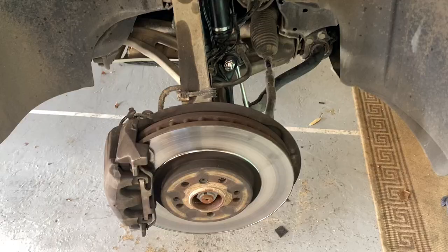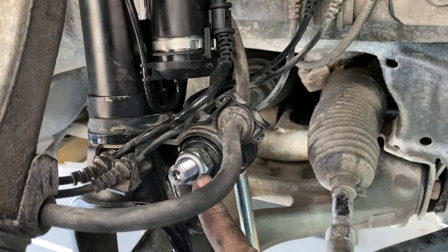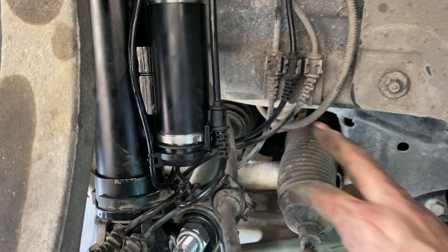Looking in here, we've got everything reassembled: the bolt and nut on the lower end of the strut fully torqued up, the top nut fully torqued up, the linkage nut to the torsion bar fully torqued up, and all the electrical connectors and brake line connector back in position as per the photo. The connector is back done up to the inside and the nut is back on the inner fender guard. Now it's just a matter of going under the bonnet and finishing up there.